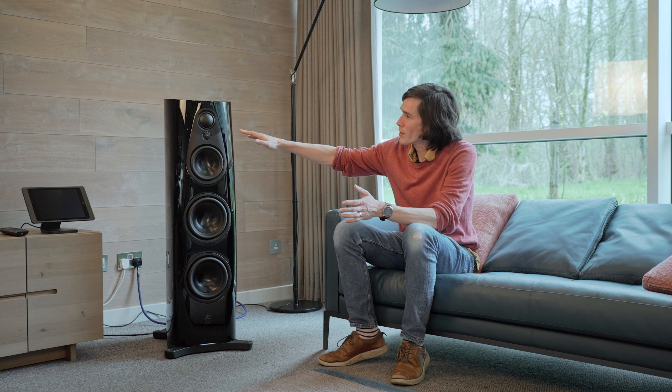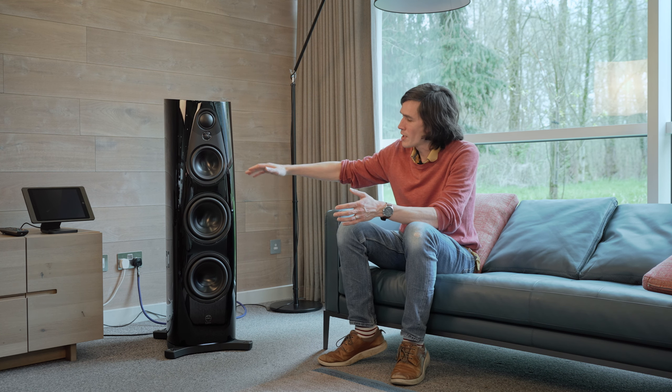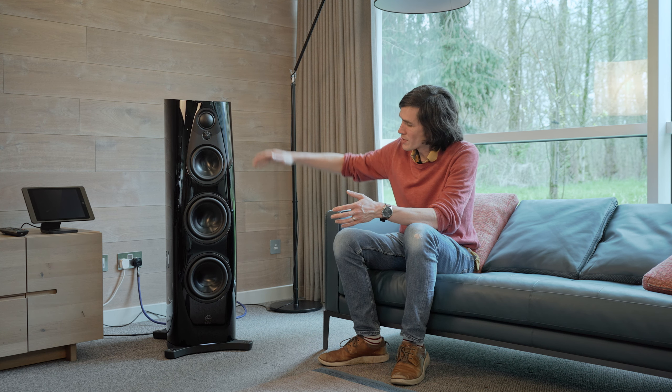My name is Adrian Chung, and I'm a product design engineer here at Linn Products. The design of the 360 really began with a loudspeaker cabinet. We were looking to improve the performance of the product by eliminating hard baffle edges from the loudspeaker cabinet to improve the dispersion behavior. To do that, we took information from simulations that our acoustic engineers ran to provide us with the optimal radius of curvature around each of the drive units, and we used that to inform this constantly changing radius that runs the full length of the loudspeaker cabinet.